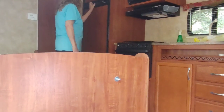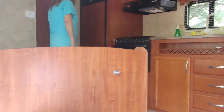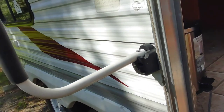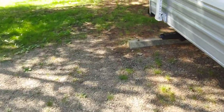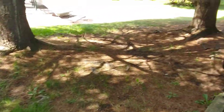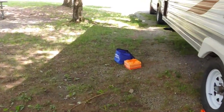The microwave is on, so that means we have electric. On the refrigerator, flip the switch to auto - I had it on gas. It should light up green. Yep, okay, we're on electric. I ran the fridge all the way here on propane to keep it cool, but now we're switching over.